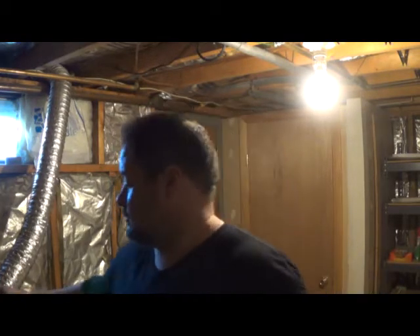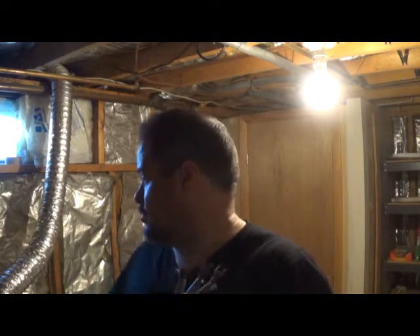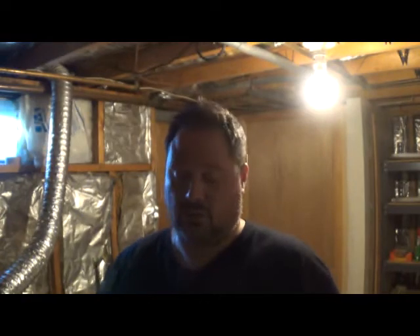Hi and thanks for watching the DIY Daddy channel. My name is Don and today we're going to be hooking up a dryer. In this house that I just purchased the dryer died, so I had to replace it. We're going to show you how to hook up the 220 volt plug. This one's a three prong plug — you want to make sure you check the outlet on the wall in your home to know exactly which plug you need. Some are three, some are four.